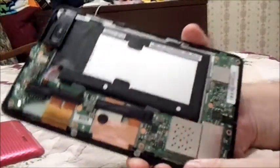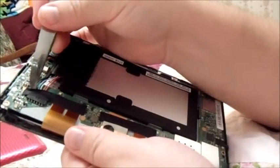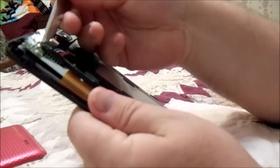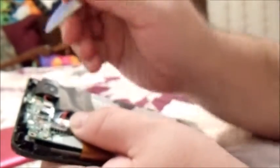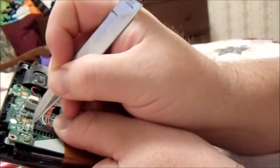That'll expose the battery. From here, just take your steak knife, make sure you get that tape off, and pretty much what we're going to do is unplug the battery and give it a few minutes to reset. This method won't reset the tablet, so all your games and all your stuff will still be on there. You can do a hard reset which might help, but this is preferable so you don't lose your information. So we want to unplug the battery — it pulls out.